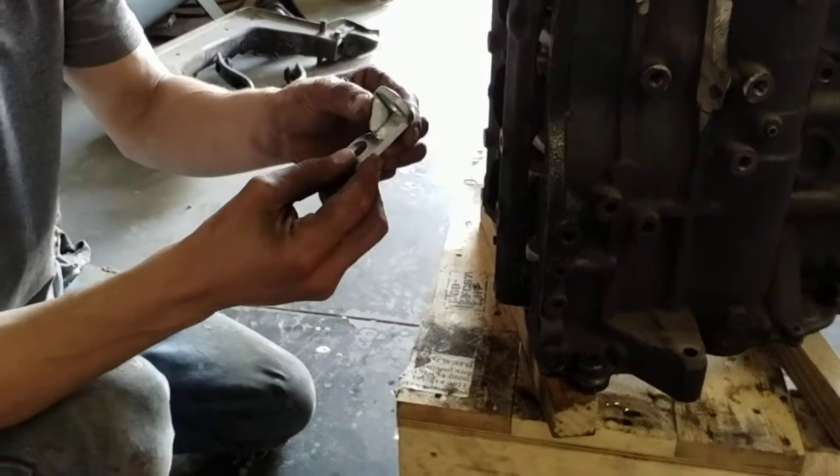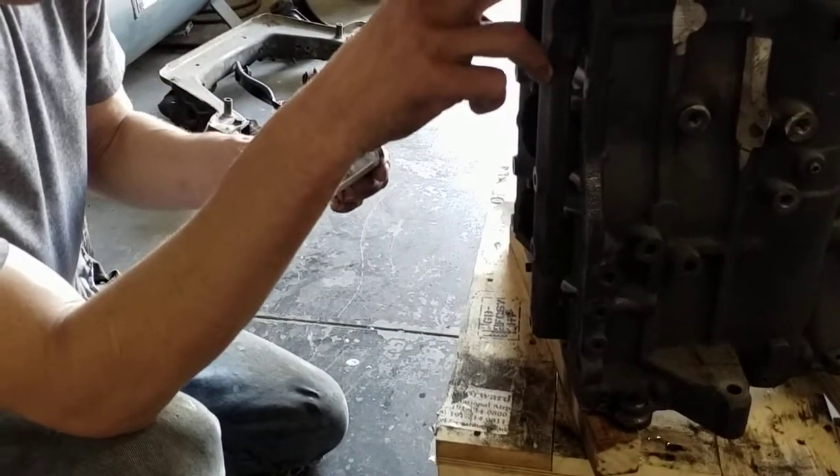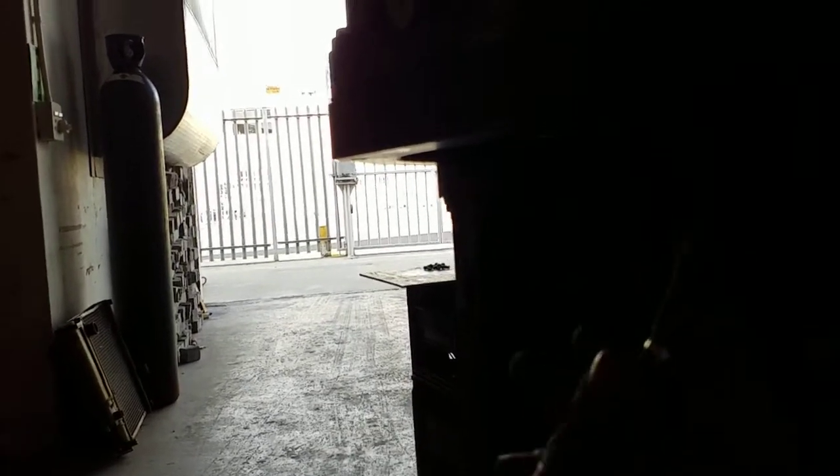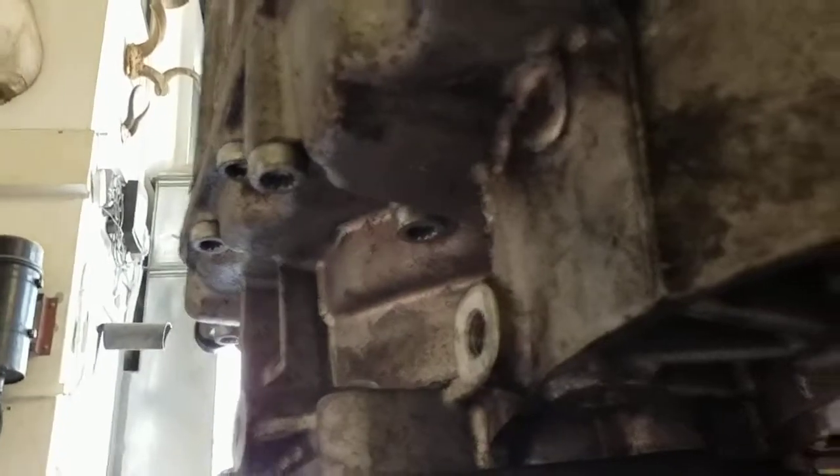So now what we're gonna do is get this bracket on. You've drilled that out to 14.5 and tapped a 16 by 1.5 thread in there. This one particular bolt is a 12 by 1.75 — it's the only bolt out of the whole hardware kit with a 1.75 thread, so just be careful not to try and force this into the plate or anywhere else.